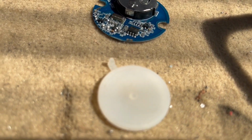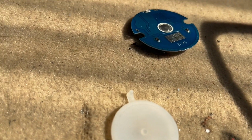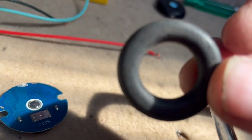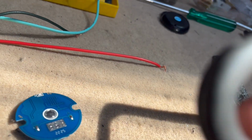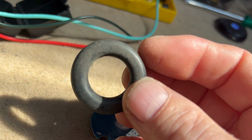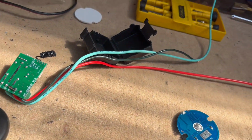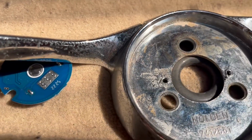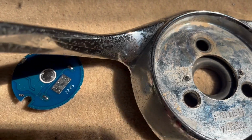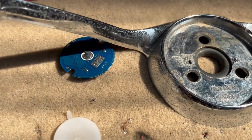The nut will activate on the silicone, which will push on this. Now, as we have no spring in the back, we then use one of these rubber grommets. I think that's probably about a 19mm rubber grommet. And you slip that over the 2 nuts, and when our steering column goes back on there, that will create your rubbering effect. I suppose you could put a spring also, but this was what I had here, and it's fairly cheap and easy to replace if it has to.